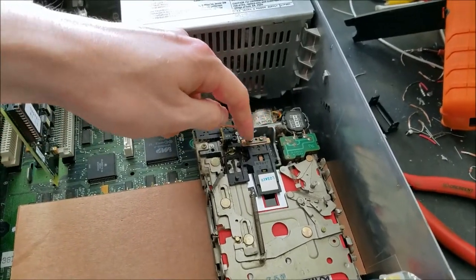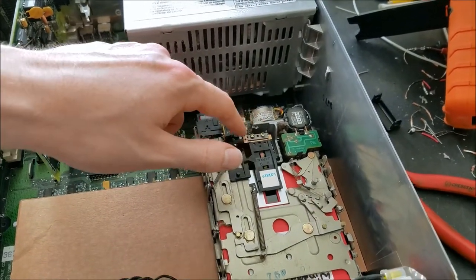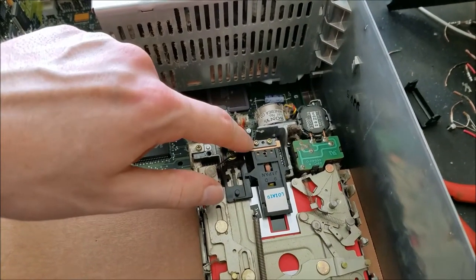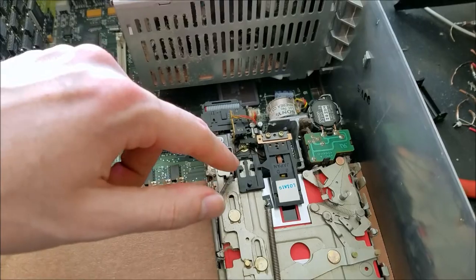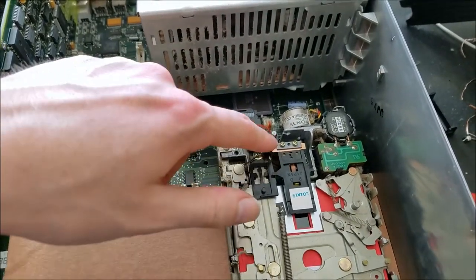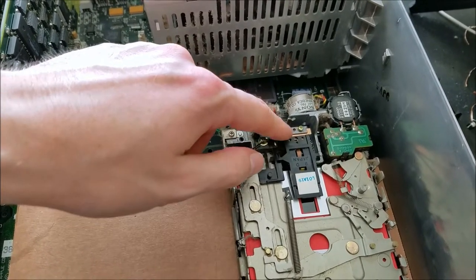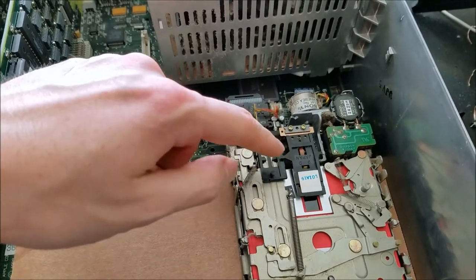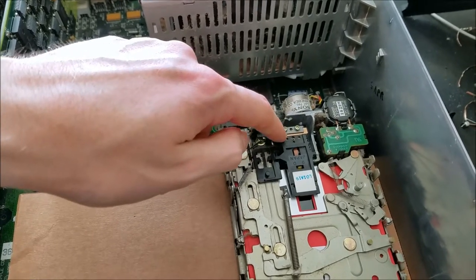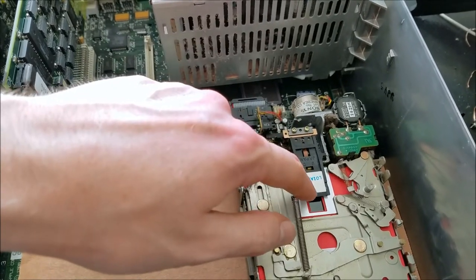What you should do is just take these screws out, take this off, and bend it back down a little bit. But I think that this is the head alignment. If you notice they've got really special screws in there - usually when you see a special screw like that, that's something the manufacturer didn't want you to take out, sometimes for good reasons, sometimes for bad reasons. In this case it's probably a good reason, because if you take this out you may not get the head back in alignment with the tracks on the discs. So I'm probably not going to take these out - I think if I did, that would guarantee ruin the drive, because I have no way of aligning the head with the tracks on the discs.